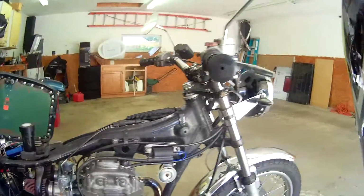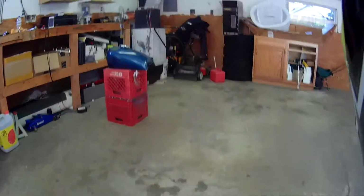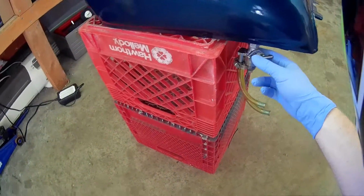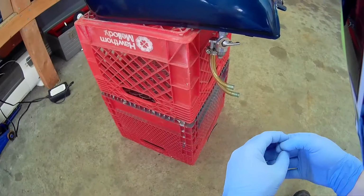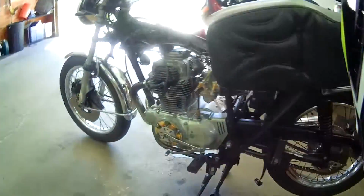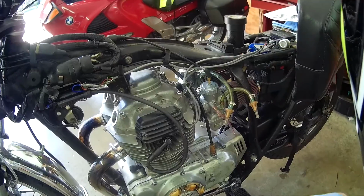Pay attention, guys. We've got a CB360. I think I've got a pretty standard petcock. I actually don't know that the one that was on there was factory, but it looked just like this. Another part that was completely ruined. So check that you've got good fitment, because if not, you may ruin your gas tank. A bit more than that, and I don't think a sealer would fix it.